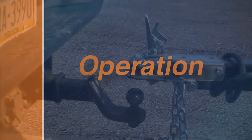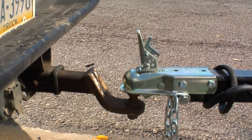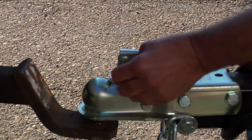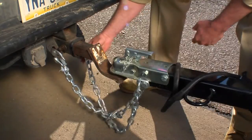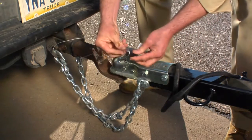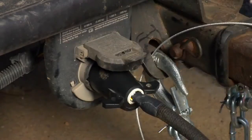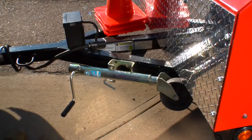Before hitching and towing the trailer, check that your vehicle uses a 2-inch ball that is rated class 2 or better. Lower the trailer hitch onto the ball and make sure the keeper engages the ball to secure the hitch. Then secure the keeper with a hitch pin. Always use the safety chains, securing them by crossing and forming a cradle. Attach the breakaway switch cable securely to the tow vehicle with just enough slack to allow for turning. Plug the trailer's 7-pin connector into your vehicle to activate the trailer lights and brake before towing. Be sure the hitch jack is tilted up and secured when towing to avoid damage.